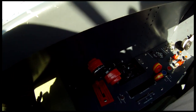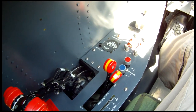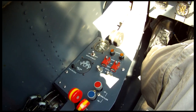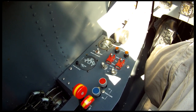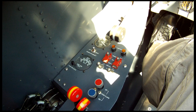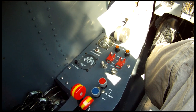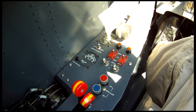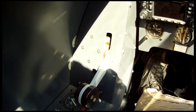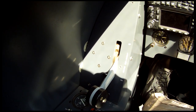Starting on the left side: standard two-each throttles. If you look forward at the throttles, you'll see two buttons — that's been changed. The original configuration had four buttons: two for the gear and two for the flaps. One thing that's different from modern fighters is the flaps are electric and you have to hold the switch down while the flaps extend. They don't go to a preset position, so you have to pay attention to that. Under air loads it takes a while for them to get out. We did reconfigure the cockpit with a gear handle that most fighter pilots are used to, as opposed to just a button like the flap up-and-down switch.